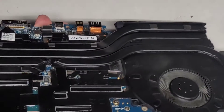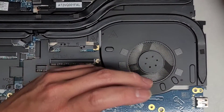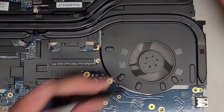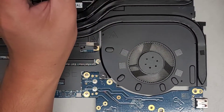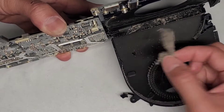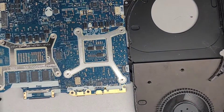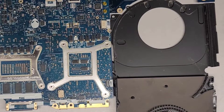Let's go ahead and do that for the other side as well. We've got the other four screws here — we're going to remove those as well. We'll flip this back over, and this one's already coming out on its own. Oh, look at that — you see that? That was clogging the fan and that's why it was overheating. Usually it's okay to just clean the dust and you'll be done, but because they left it so long, I think it was probably getting so hot, I'm going to have to redo the thermal paste. So I'm going to clean this up — brush the dust out, blow the dust away, and then we'll continue.